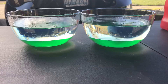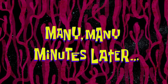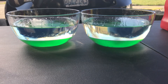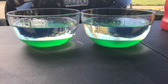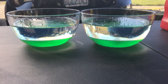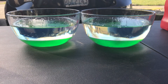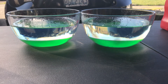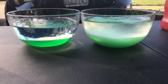It's completely separated — the water is all on the bottom, which means it's gonna get sucked up first. That's really gonna mess up your engine — it'll just push water through the whole system and gum it all up. So I've got two different kinds of HEET. There's a yellow one — a gas line antifreeze and water remover — and I'll link both in the description. I'm gonna pour the yellow one into the right container here.